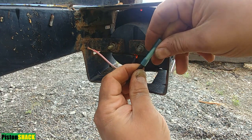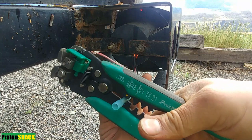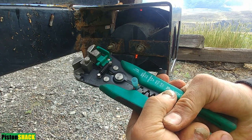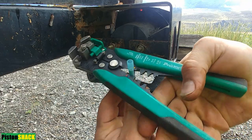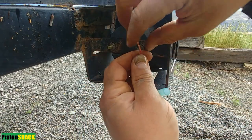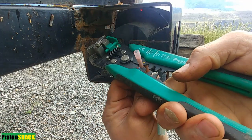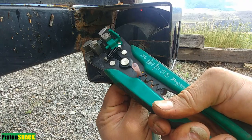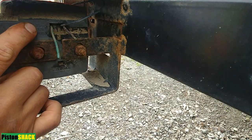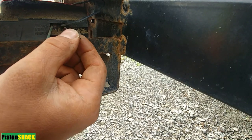As you can see, those two black wires for tail lights — I twist them together and I'm using heat shrink crimp connectors. Let's do one side, then go to that red wire which is our left turn signal and brakes — just crimp that connector as well.